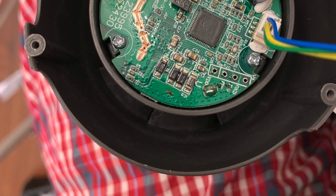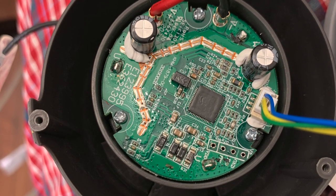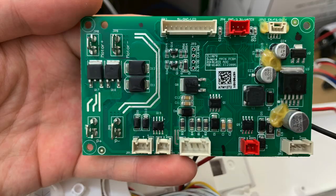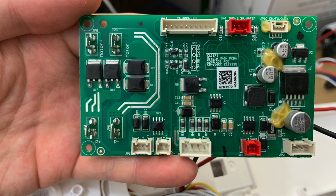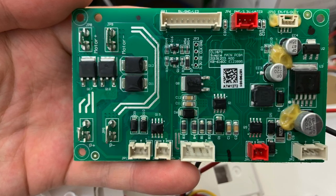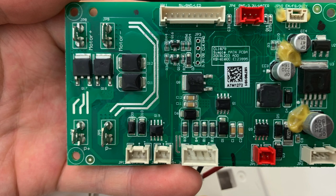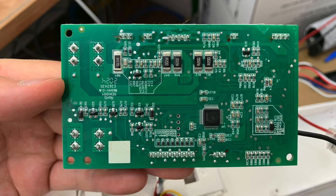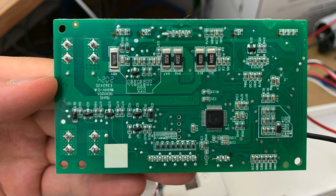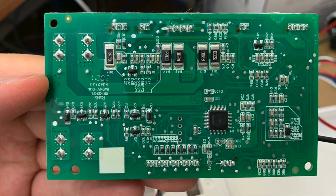Unlike the Dyson digital motor, this one looks like it's three phases instead of just two, and it's powered by a microcontroller — an 8051-core FU6818Q — so it's not a 32-bit ARM like we usually see controlling motors. The motherboard is pretty simple: it's got a step-down converter — an LM2596, the really common step-down converter — a bunch of housekeeping for the battery, and a bunch of MOSFETs for switching motors on and off. Moving on to the back, we can see the STM32 microcontroller that runs the whole operation, and what looks like four to five big sensing resistors. That will probably be how the chip detects if the brush roller is jammed — if the motor stalls, the current will rise, and the chip can alert the user that something's wrong.